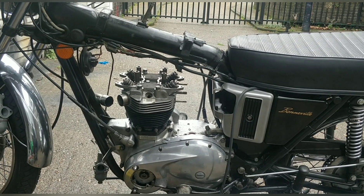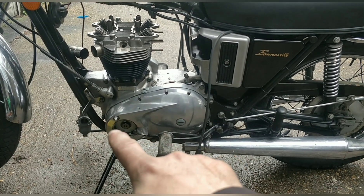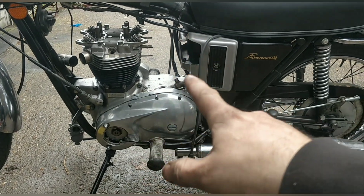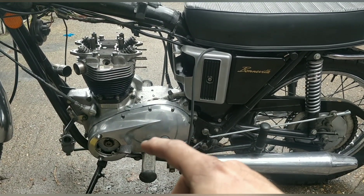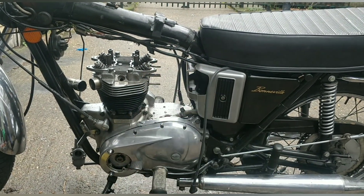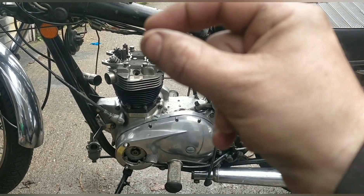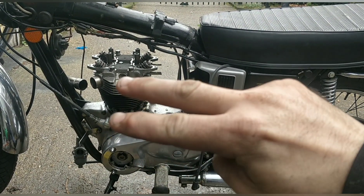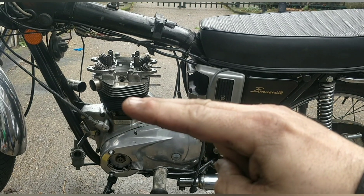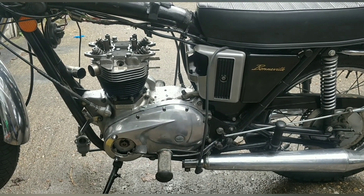Once I put the cams - the top part - back on and adjust the engine, I'll be able to see if it's functional. What you do is you go to top dead center, see which one has less slack in it and tighten that one, go back around 360 degrees, do the other side, and do the same on the back. You've got to be careful with the second one that has lots of play because it could fall off the push rods - it's a real fiddly pain this system. Get the bottom push rods seated first, turn the engine, keep your fingers on the top to make sure they're lifting with the engine, then put the top on and look in with a light to make sure the balls sit in where they should be.